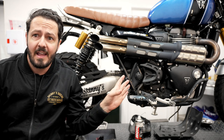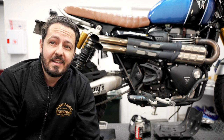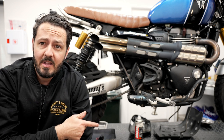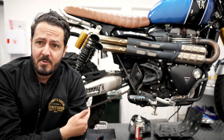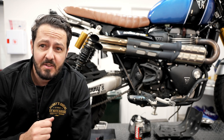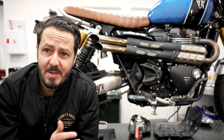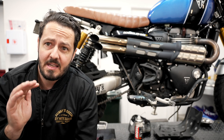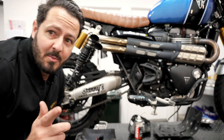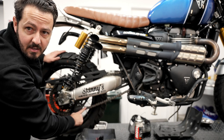I have a hoist and I have access to a paddock stand. Those things make it really easy — like a 30-second job. I just throw the bike on, lock the front wheel in, and then lift up the rear with a paddock stand. That's super easy for me. It might be a little more difficult for you at home if you don't have those sorts of things. You can still lube your chain without them, but it's just not going to be easy. You're going to have to basically roll your bike backwards and forwards so you can get at every single link on that chain.